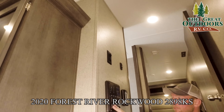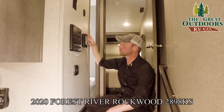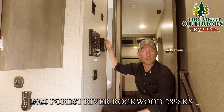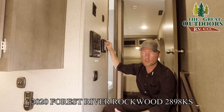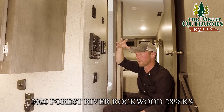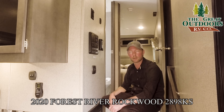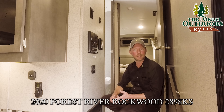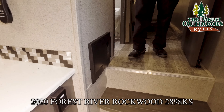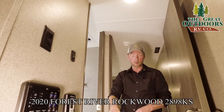Some of your main lighting control switches are right here, with regular on/off switches throughout the coach as well. Digital thermostat controls allow you to set up two separate zones — this unit was brought in wired for a second air conditioner. It doesn't currently have it, but it is a 50-amp service coach, so if you wanted to add that second air conditioner you can set up separate zones for the bedroom and the living area. There's also a built-in Wi-Fi ranger, which they've only started doing in the last year or so, with the ability to become an LTE network if you work with your cell phone provider. Down below is the fuse panel with an LED light associated with each fuse — if a fuse pops, a little red LED will light up through the smoke screen.